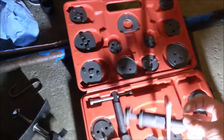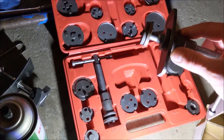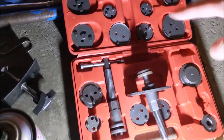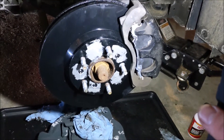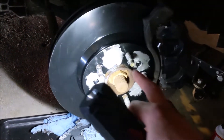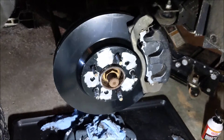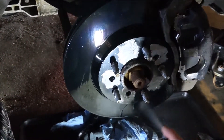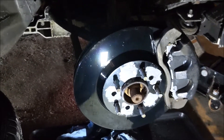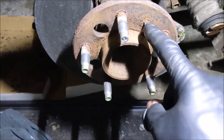I have this tool - the pistons need to be spun in as they're being compressed. Now I've got my fronts done, I'm moving to the back. These bolts - what a pain. On my driver's side, I got my hex socket in there and the thing snapped off. I'm trying to drill all around the head of the screw because I can't fish that piece out. I just drilled it out. I'm not putting them back - those are the stupidest things I've ever seen. When you put your rotors back on, you put lug nuts on to hold everything in place.